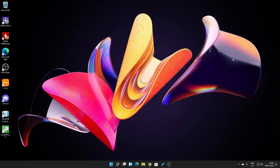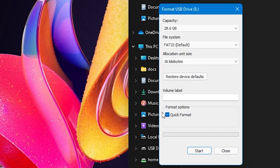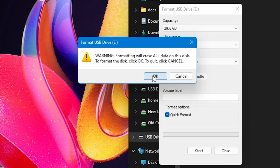The first thing we want to do is put our USB drive into the computer. Let's make sure it's formatted correctly — right click on the drive, choose Format, and make sure it is set to FAT32. Set allocation size to default and the volume label should ideally be blank. Once you're happy, click Start and you'll get the warning that it will erase all the data on this disk. Make sure you're using a drive you can erase, and when you're happy click OK.